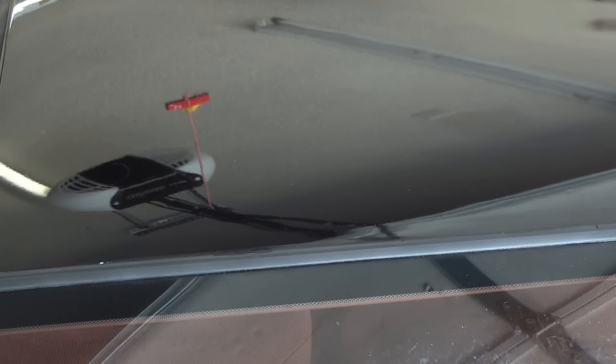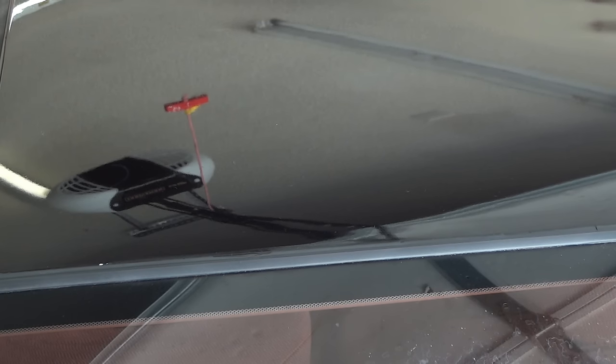I have finished all the buffing and it looks extremely good. I did not cover some plastics, which was a horrible choice — now I have pink on the plastic, so I'm going to wash them and armor all them to make them look original again. When you do it, make sure you put painter's tape on the plastics to help protect them. After you've polished and buffed all the oxidation off and sanded, you're going to need to wax, because sanding removes a thin layer of clear coat. So don't forget to wax your car every few months, especially in the harsh seasons. Let's go ahead and wax this car now.